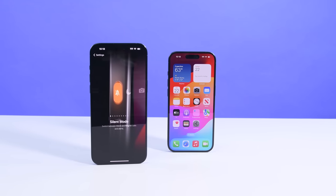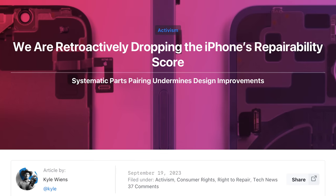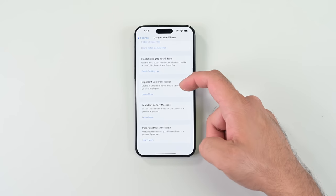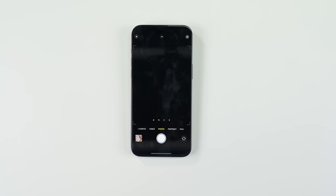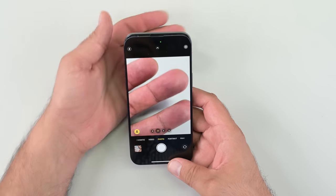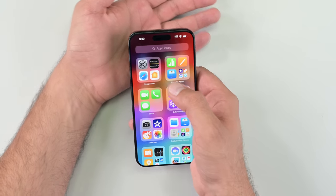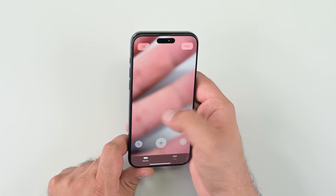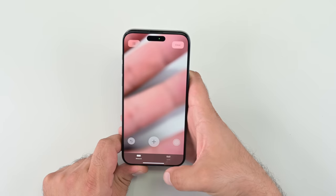With the hardware fully disassembled, we need to stop and take a look at the software. We've finally codified our parts pairing rubric and rescored the 14 to have a point of comparison. We've definitively confirmed that the iPhone 14's parts pairing issues, calibration issues, and unresolved bugs remain present in the iPhone 15. The front-facing camera bug is particularly egregious and has gone from a calibration problem to a de facto parts pairing problem, given Apple's refusal to fix it. This year's new addition is the LiDAR sensor, which now crashes if the sensor is swapped out. These bugs need to be fixed, or else they might as well be paired with the logic board with a tidy Apple warning saying: this phone is property of Apple.